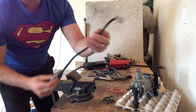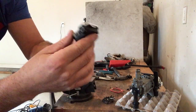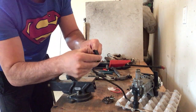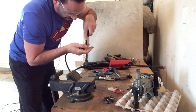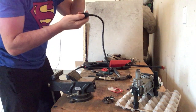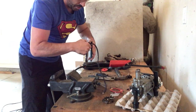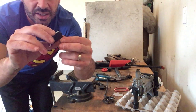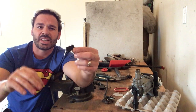There is also another piece of hose inside that will add up in weight. But by the trigger there is a box — what we call a silver contact or relay box. I am going to pull that out using a screwdriver. Sometimes they are connected with a type of screw, and this one is bolted in. The rest of this wire is going to go into my 60% copper recovery. Inside these relay boxes — anything you have like a trigger that you click — is going to have a little bit of silver in it as well as a little bit of copper.